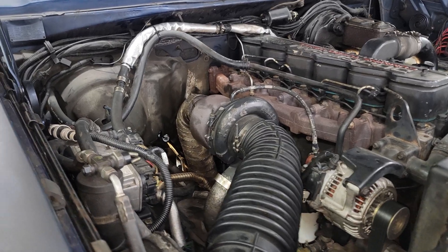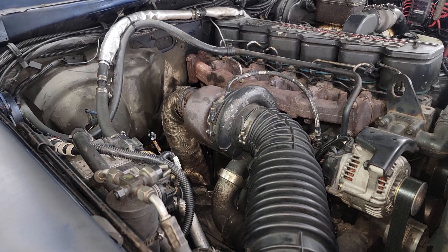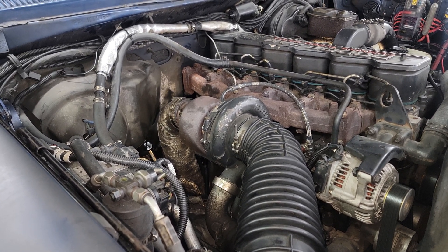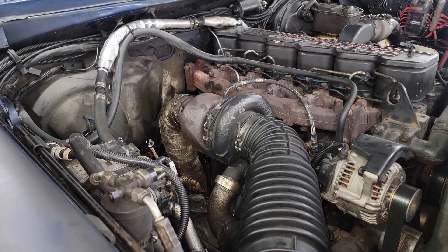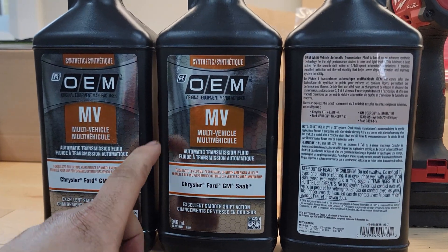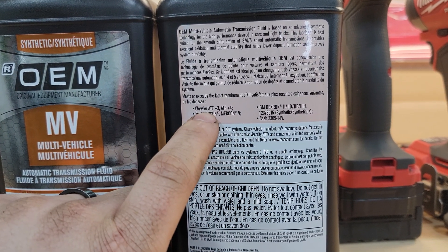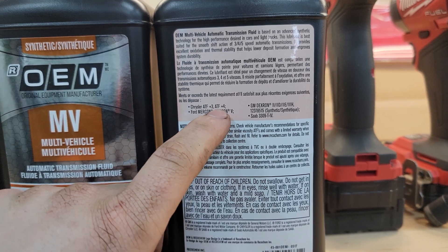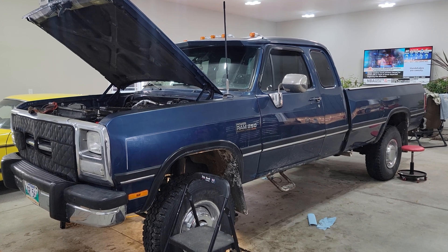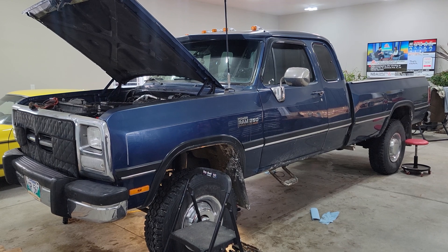At this point with the transmission lines done, the last thing we need to do is refill the transmission fluid. We want to check the transmission while it's hot, idling in neutral. We need to get the truck up to temperature, run the fluid through all the lines and system, get it nice and hot, and check the fluid level in neutral to make sure it's at the correct level. This is the transmission fluid I'm running — it's synthetic OEM multi-vehicle, good for Chrysler ATF Plus 3 and ATF Plus 4. ATF Plus 4 is the one I usually look for to put in this transmission. That wraps up the installation of the new transmission lines from Evil Energy on this 1993 Dodge W250. Thanks for watching and I hope this one helps. Stay tuned for the next one. Cheers.